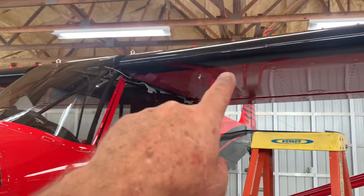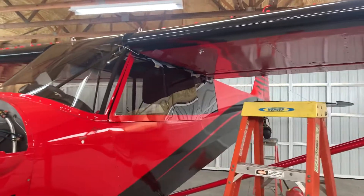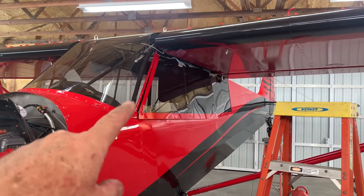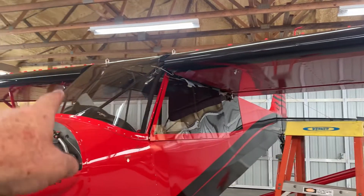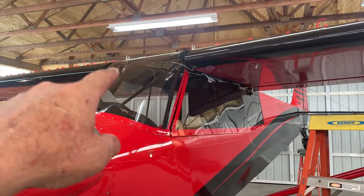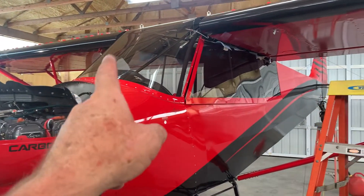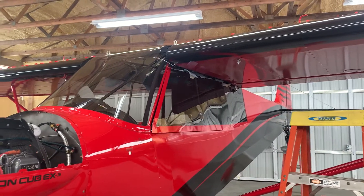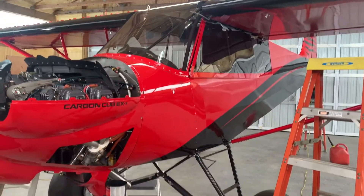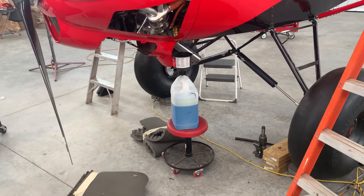At that point I'll know I've got about 10 gallons total in both tanks — less the little bit used starting the engine and taxiing. Then I'll top them off. I'll turn the fuel selector to off so I'm not cross-feeding, fill each tank, go back and check they didn't go down, and make sure they're completely topped off. With a 44-gallon max and 10 already in there, I should be able to put 34 gallons in at the fuel pump — so that lets me know whether I really have 44 gallons in my tanks. That's the way I do it, and I think it's pretty cool.